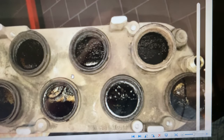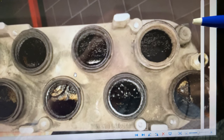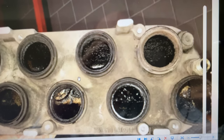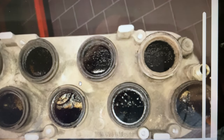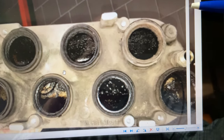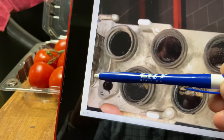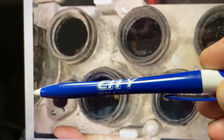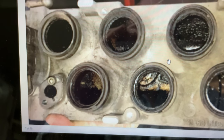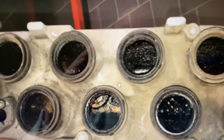If you have a rough idle, the first thing I would do is disconnect the two vacuum lines on the upper intake manifold. One is for your transmission modulator — take that off and cap it. The other goes to your economy gauge and your AC vacuum system in the dashboard for all the vacuum valves — disconnect and plug that off too. Also plug off the three hoses coming out here that go to the two vacuum valves and the purge valve for your charcoal canister. Leave only the advance vacuum connected — the vacuum for the advance on the EZL unit, which is a different port on top.